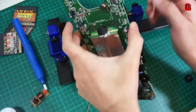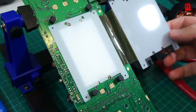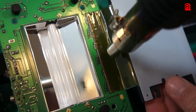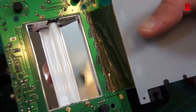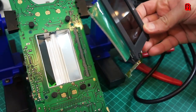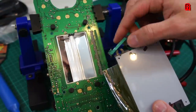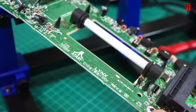We can now move on to the removal of the LCD screen. We want to take particular care when removing it, because we need to reuse the connections under this ribbon cable, and it's quite firmly glued into place. I chose to heat the glue to make removal a little easier. That went quite well, meaning the screen is reusable. I did get a little bit lucky though, because the secondary cable came away of its own accord — that could just as easily have snapped, so do pay more attention if you're attempting this yourself. The old backlight and associated fuses play no part in our new screen, so let's get those removed.